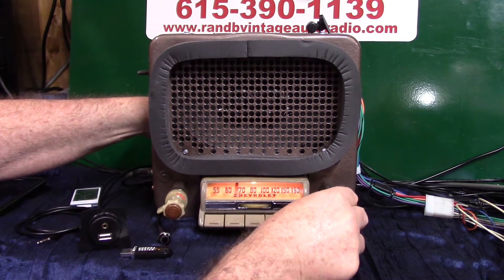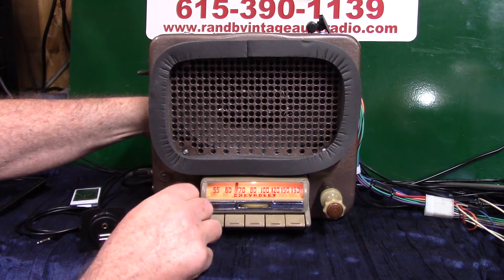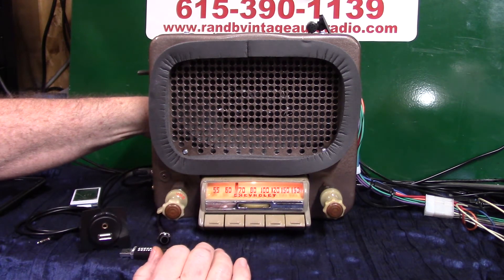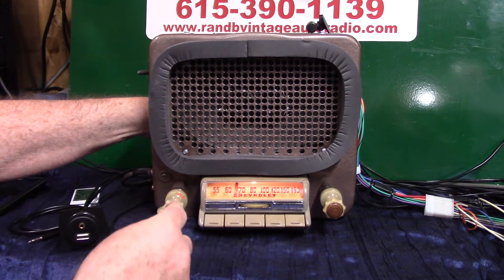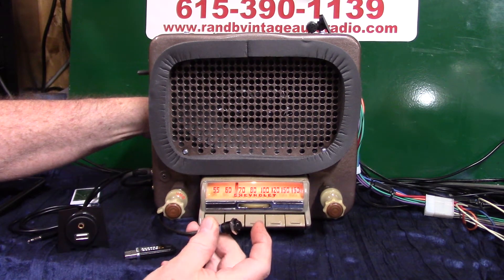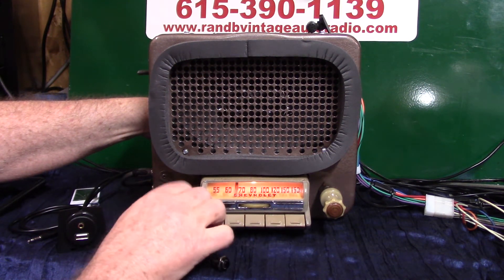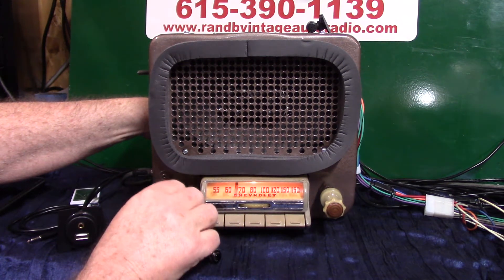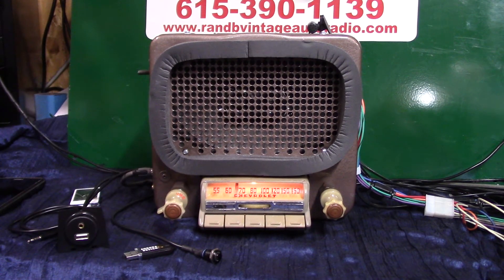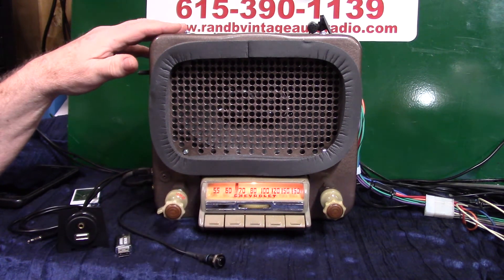You want to go to AM radio — just simply turn the unit off and right back on. You can know where you're at at all times on AM and FM; this is called Voice ID. You can get to it by turning the volume up three times or punching this once — it'll announce the station, like 'AM 650.' Turn the radio off, right back on, and it takes you right back to FM stereo. You might be looking for something specific — the ball game might be on — so you can actually find out which station you're on using the Voice ID.